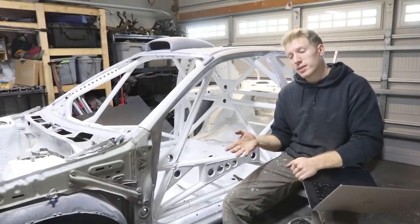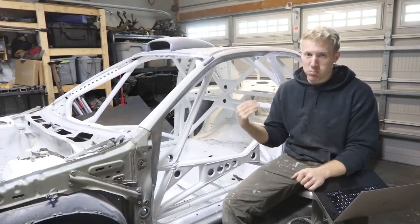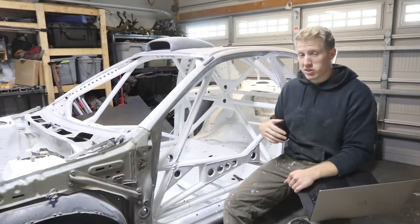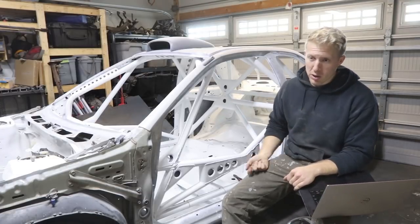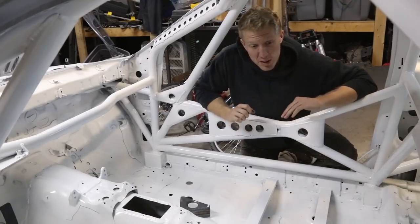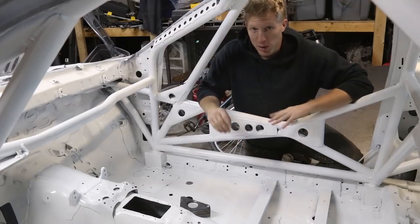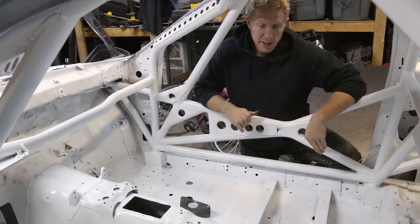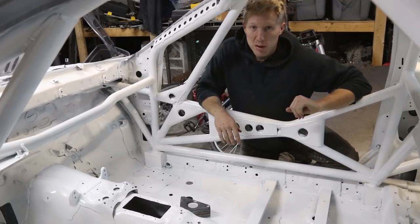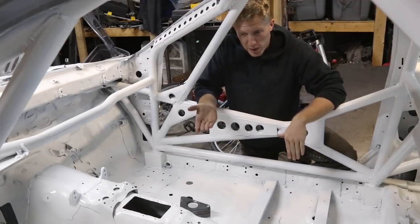One thing that makes it easier is you can have pieces pre-cut to size. I have a plasma cutter and if I hook up a straight edge it works out pretty well. You have to use eighth-inch plate or three millimeters pretty much anywhere the cage comes in contact with the shell — you can't just weld bars to sheet metal because it'll punch right through in a wreck. Just Google that Mustang that rolled over with a bolt-in cage straight to the sheet metal — the entire top was completely flattened.